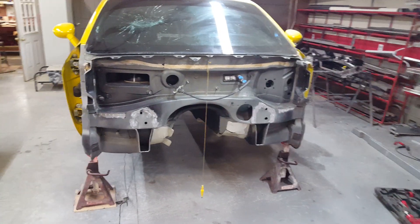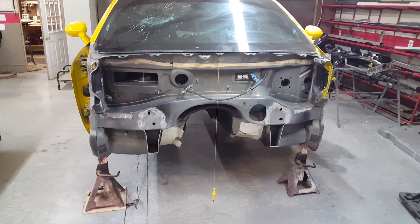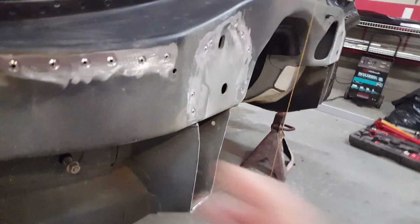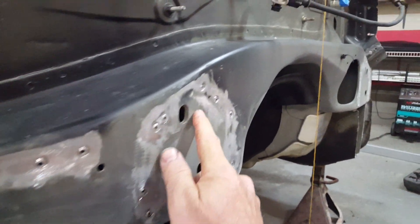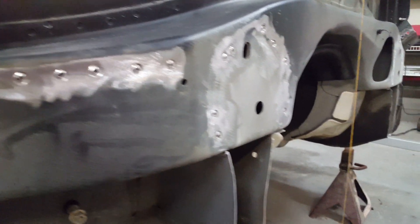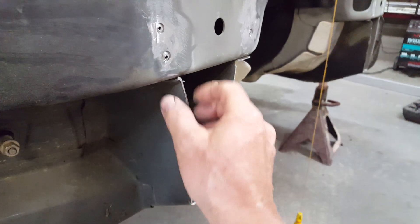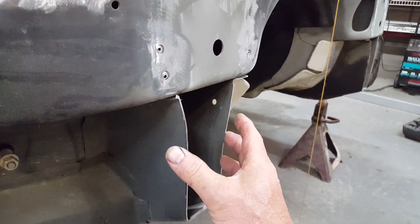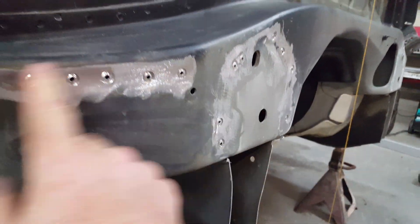So this is what's been going on - we've got this cleared down to the firewall, the frame rails cut off right there at the level with this outcropping here. This is where it was spot welded on in this area, and I just cut this area. What I'm going to do is drill this out and rosette some plating on the inside here so that I can slide the donor car front clip on here, and then I'll respot all this in.